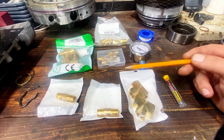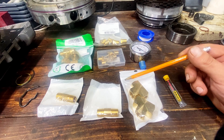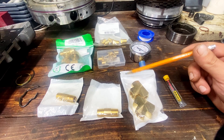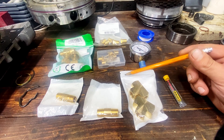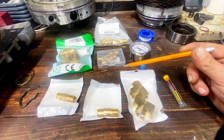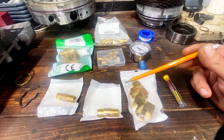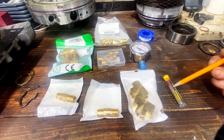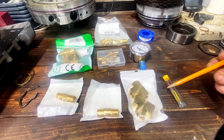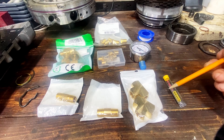If we pull an actual vacuum on the valve body with no leakage, that's a sign things are too tight-fitting and we need to address that. What we're actually measuring is leakage between components — there's a certain amount of leakage for the valve body to function correctly. But if we pull a full vacuum and find things are fully sealed, we need to either polish the bores or address why things are too tight-fitting. We're also going to need a number 65 drill bit. This will contribute to being able to set calibration when we actually go to test.